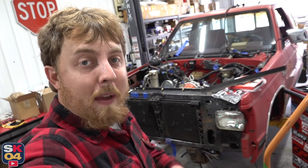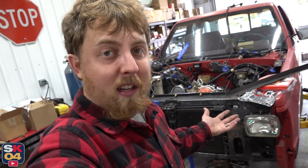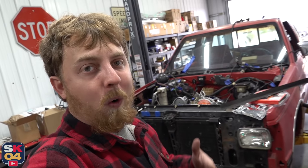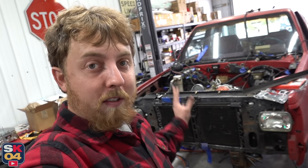My main thing was making sure none of the vital cooling components were rubbing on one another, because obviously there's going to be a lot of vibrations in the front and you don't want a vibration to turn into a hole in your radiator or in the condenser. That was the primary focus of putting everything together the way I did. Now I'm going to take everything out of the back side so you can see what I did at the back of the condenser and how everything else fits in.